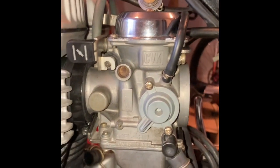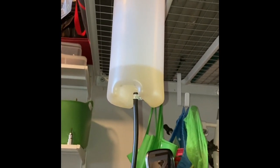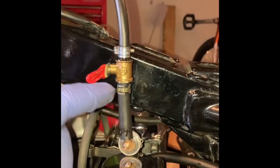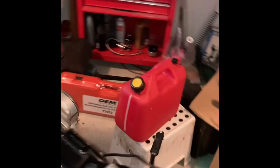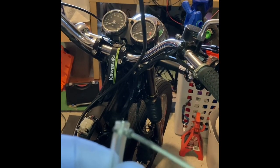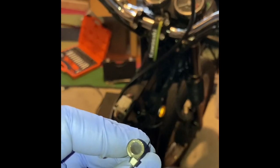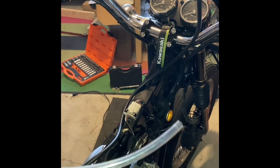So how do you do that? First of all, what you need for this is some sort of a fuel tank. In my case, I took the fuel tank off and I have this kind of fuel tank — a plastic bottle that you can get on Amazon or in China for minimal amount of money. I just hooked it up like this so that you have a constant flow of fuel into the carburetors. You also need a safe container for the fuel as it leaks, and a hose — this is a five millimeter hose. By manual you should have a six millimeter diameter hose, about 300 millimeters in length, so 30 centimeters — basically a 30 centimeter fuel line.